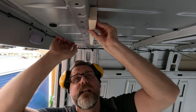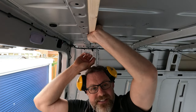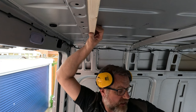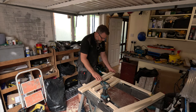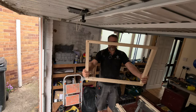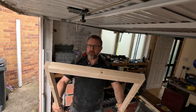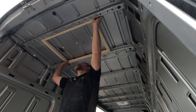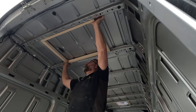That's beautiful — the additional problem is this roof is curved. I'm really hoping this is going to work out, kind of going on a wing and a prayer here. I'm going to make this frame, test it for size, test it against the cowl, and I'm not going to make any holes until I'm totally sure. There we go! This one wasn't as easy as the Max Air fan — it's had to be modified massively to fit the shape of the roof. It's a little bit off square but I can rectify that, not a problem. I must have cut one with a bit of an angle on it, but otherwise I'm happy.